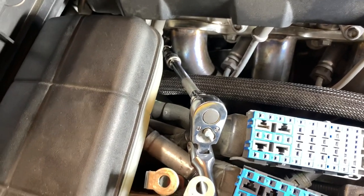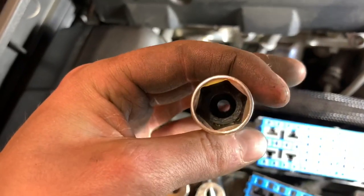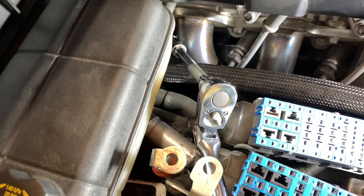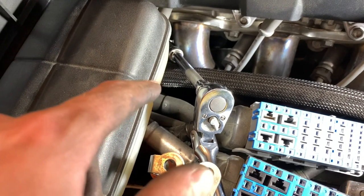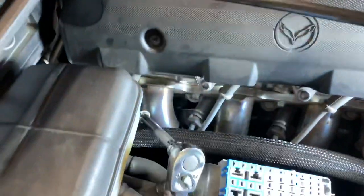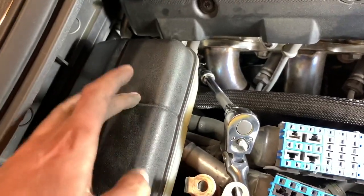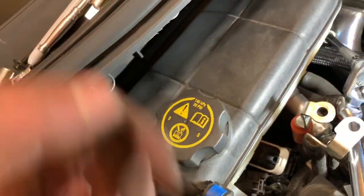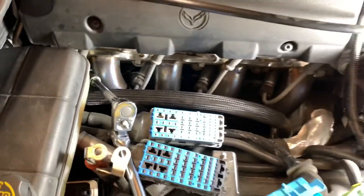I got the spark plug sockets. Take out the spark plug, put the new one back in, and then torque it down with a torque wrench at 15 pounds. Hopefully I can get the torque wrench in there — this one is going to be the hardest because this thing is in the way. I took the screw out but it's not coming out, so I'm just going to try to do it with it still there. You have to take the fuse box out, which is right here.